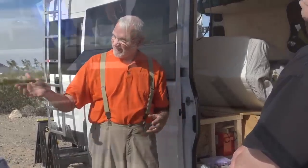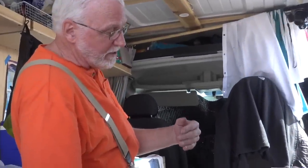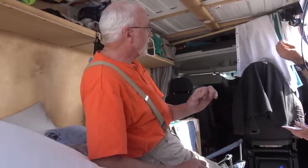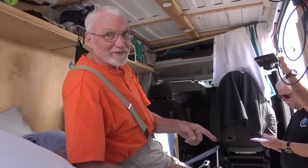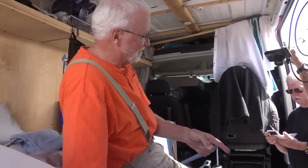And so I looked for something that was bidirectional, voltage sensitive, low draw, and had a few extra control lines. What I chose is a company called Sterling Power Engineering. The product line is called Pro Connect, and there are a couple of different kinds. I use the CVSR, which is current and voltage sensing relay, I think. I think that's what CVSR stands for. It's pretty close anyway. If one of those words is wrong, I claim no authority.